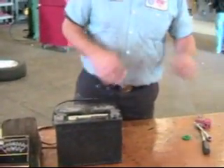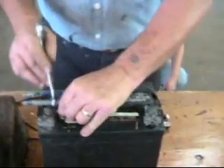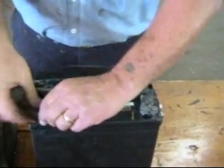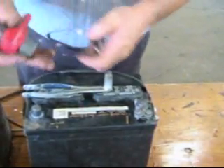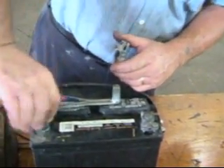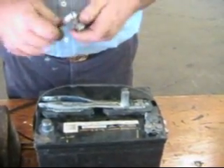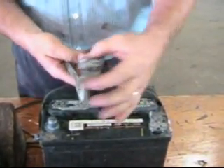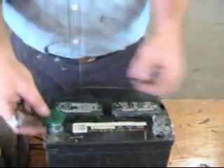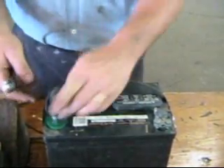The most common electrical problem in the car is bad battery clamps. To change your battery clamps, take them loose. People say, 'I looked at them, they look just fine.' They look fine, but down inside there's a lot of corrosion. You've got to take some sort of cleaner — this is a knife-style cleaner — and clean up the post. Having removed some of the oxidized lead, if you have a pair of battery spreader pliers, you can spread the clamp back out, get it back on, and tighten it up. You should put down an insulator — I've got the wrong one; put the green one on the negative — but the insulator helps prevent that self-discharge I showed you before.